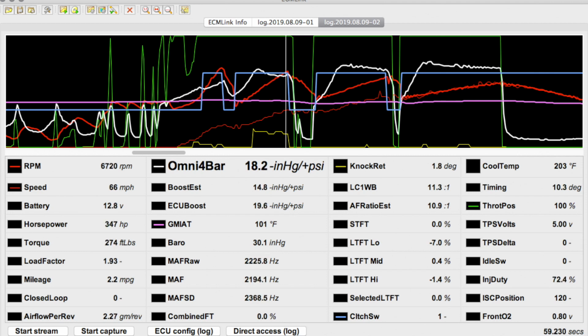The knock sensor's under control for third and fourth, and I might be able to clean up second gear by playing with the boost controller a little because second is really peaky now. I've clearly got a lot of work to do, but just look at that blue clutch switch value again.